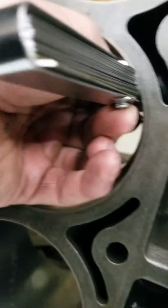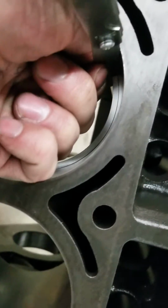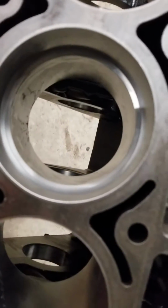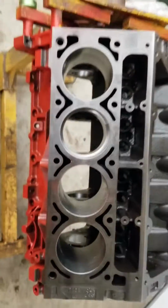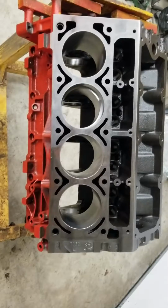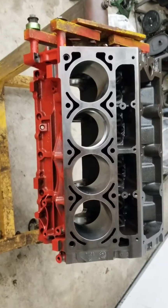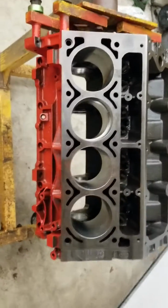Oh, so yeah, I don't know if you can see that, but now I'm sliding in perfect. Still a little tiny bit tight. Pulled up my ring a little bit, so what I'm gonna end up doing is just shave it down a little bit more. But as you can tell, that little mod, as long as you do it loosely and slowly, won't take off that much. But if you need to really take a chunk off of it, you totally can. So, but that's the first part of this engine build.